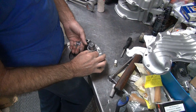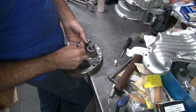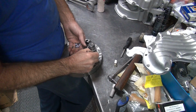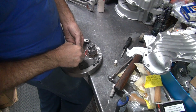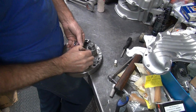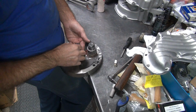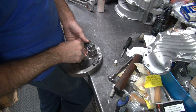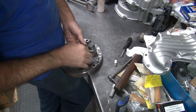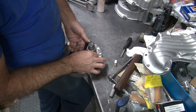And you make every roller shorter. Once again, every now and then you get some extra rollers out of that. Same length of bar stock. Every 5 or 6 bearings, you get an extra bearing. More cost savings. Multiply that over thousands of bikes, it makes a difference. It also makes a difference in quality, but they don't care about that.